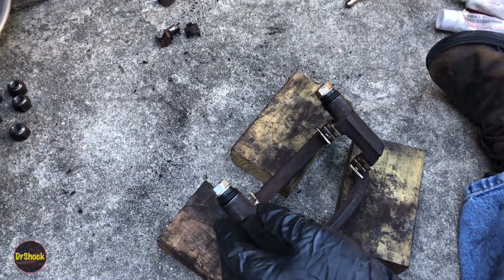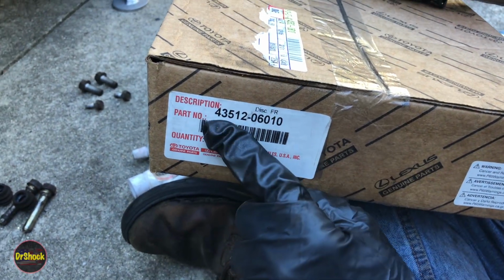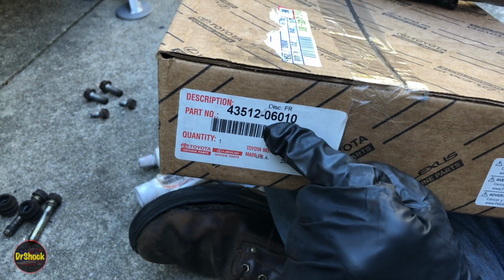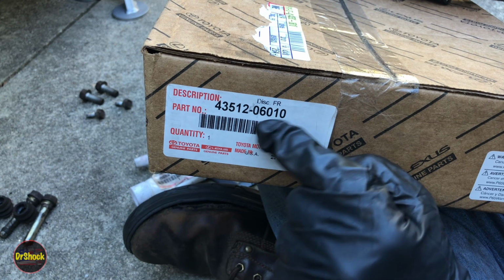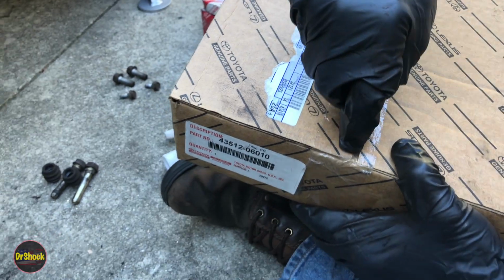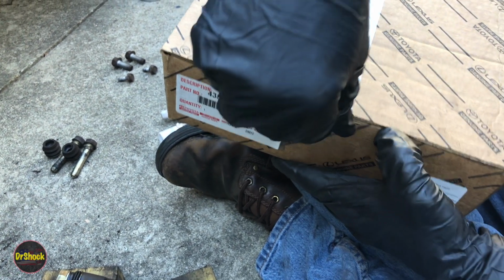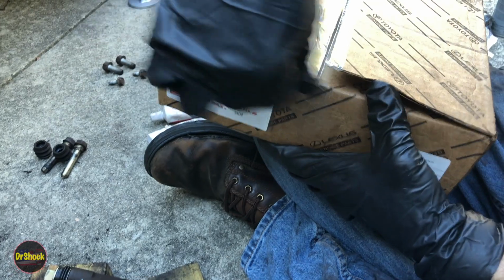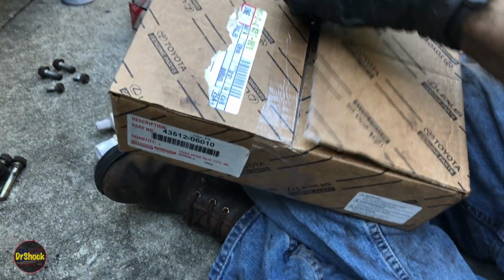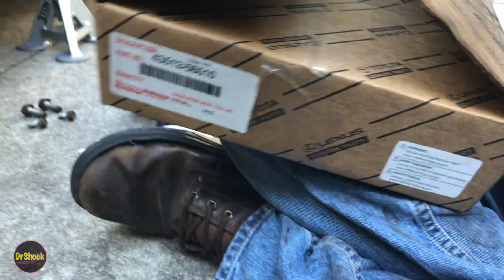So let me show you the rotor that's correct for this 14-inch wheel. All right, guys, the disc for the 14-inch wheels is 43512-06010. I'll put the part number for the 15 in the description along with this one. The difference is this guy is smaller, obviously. I believe the diameter on this one is 255 millimeters, whereas the 15-inch one is going to be 275.